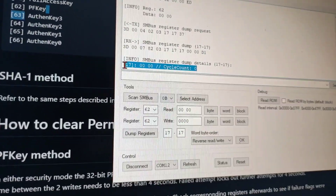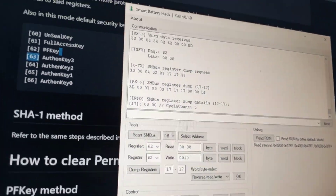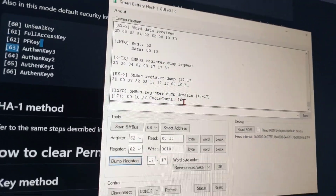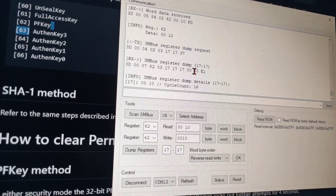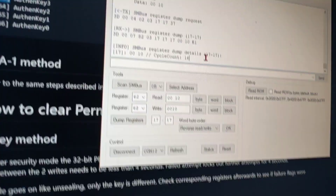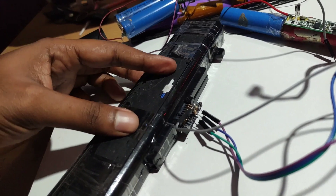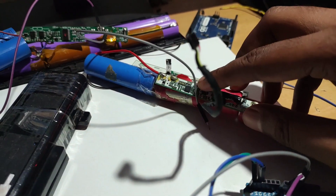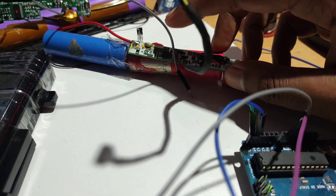The cycle count is now reset to all zeros. With this simple tool the cycle count has been cleared to zero. However, I have another Lenovo V310 battery here with the bq9000 IC — it is a very advanced IC. We cannot simply crack that IC with this little board; this tool is only capable of handling these simpler battery types.